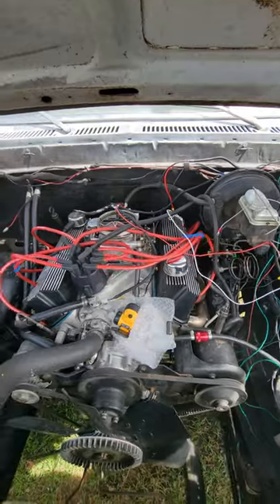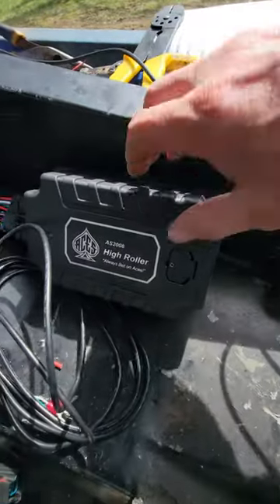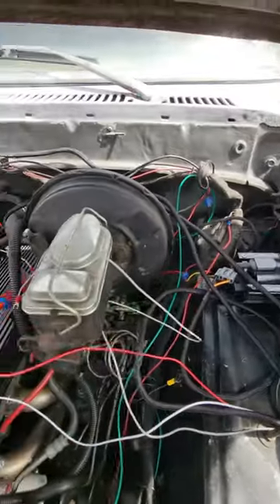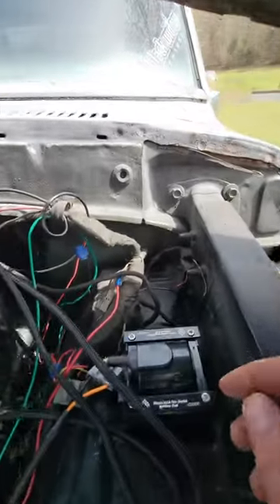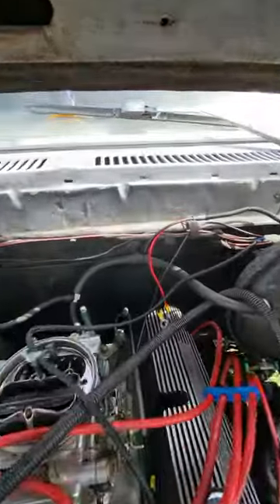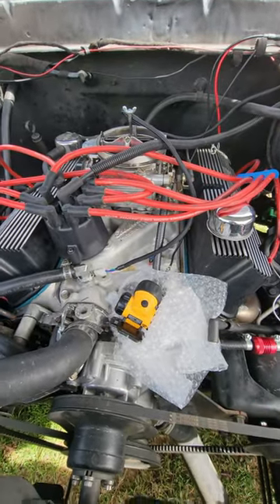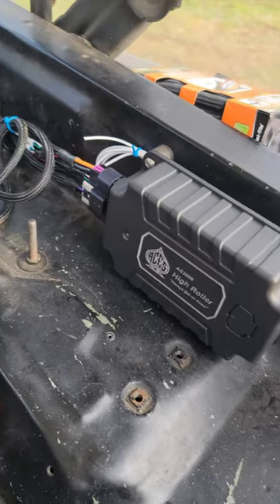This is under the hood of a '77 F100 with a 302. We've got plenty of room in the fender well — this is where we're going to mount it. The control box will mount sideways right there, and the wiring harness will run to the coil and feed over to the distributor. There's a grommet right back here where our handheld plug will feed through inside the truck for key-on power. The main black and white wires have to come all the way over to the battery for main power.